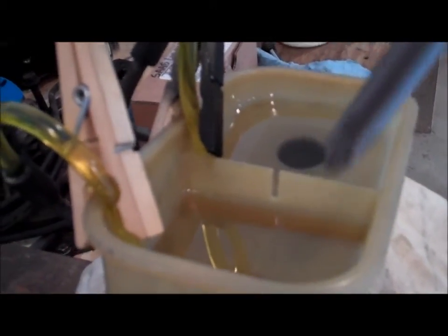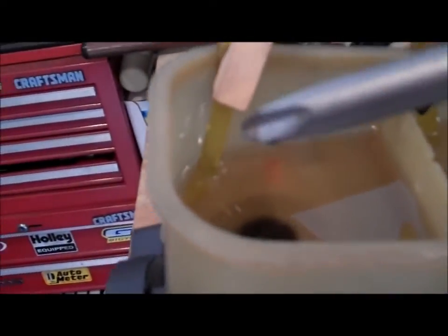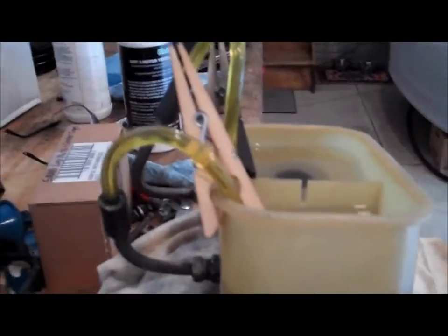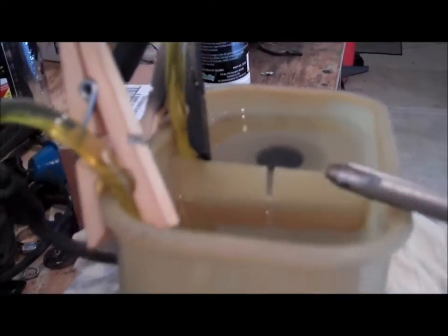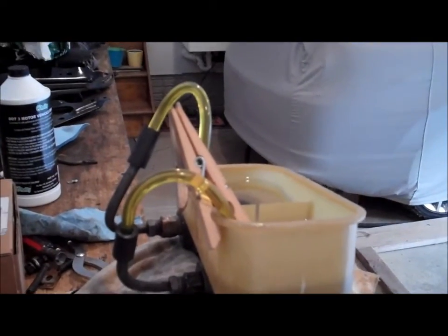You get nothing but a solid stream of fluid — you'll see all the air bubbles coming through the front and rear of the master cylinder. Air rises to the top, so you want to make sure those hoses are down deep in the reservoir so it's pulling fresh fluid that isn't contaminated with air. Keep pumping until you work all the air out. The front reservoir usually goes through the procedure first, followed by the rear. This is all primed, all bled, ready to go on the Cutlass.